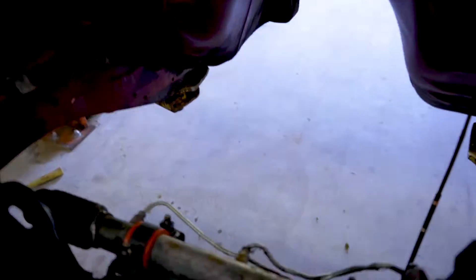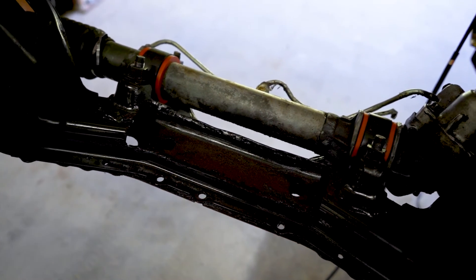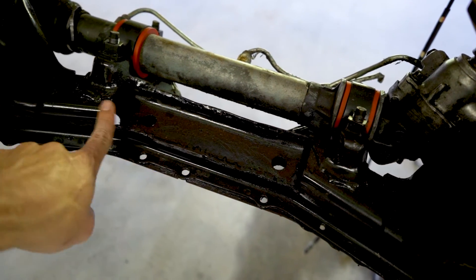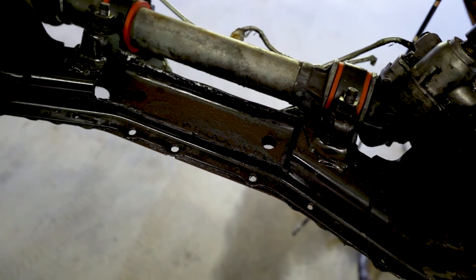One thing I mentioned was the cross member notch to clear the GTO pan, but I couldn't show it last time because it was under foil. You can see it now. What I did to notch that cross member was basically cut a section out and flip it backwards — that part right there used to be right in there. I made a cut, flipped it over, welded it back in so I still have some support. That's how we did the cross member notching for clearance. The oil pan fits way better now and doesn't hit the cross member anymore.